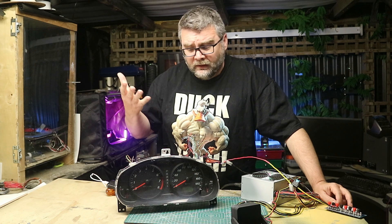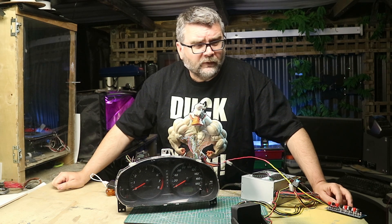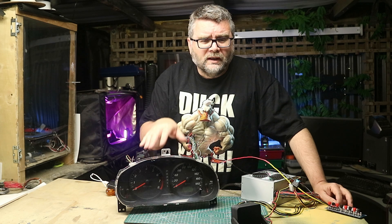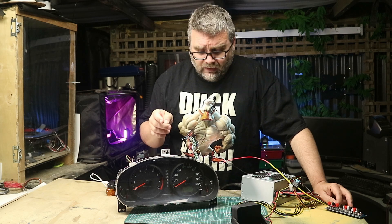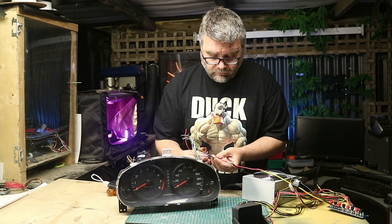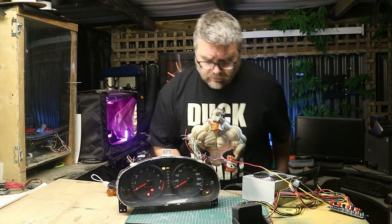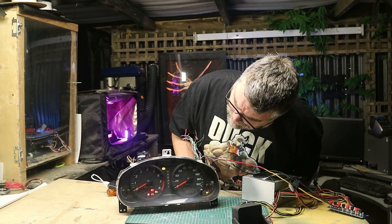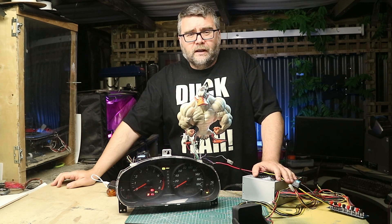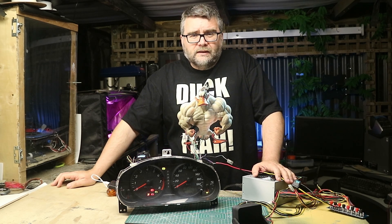The dials did the sweeping motion just to say they're up and running, but there are no dash lights. What I found with this unit is that powers the unit up so it's working, but it needs an ignition signal — so the ignition needs to be turned on for everything else to power on. I managed to find a wiring diagram to show me where that was. Once I hook up the ignition wire, we should see all the other lights turn on — the airbag, handbrake, battery, check engine, ABS, and all those things lit up. So it's alive. The next thing is to figure out how to get some CANBUS signals out of the unit.